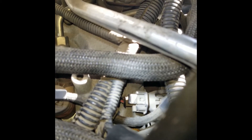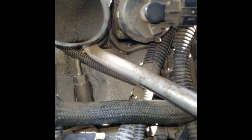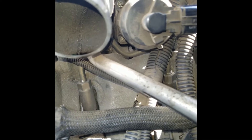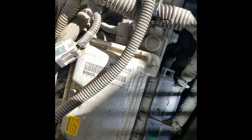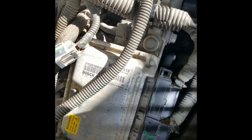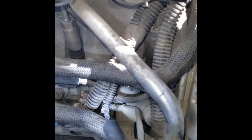It's interesting — the jiggle test identified that it was in fact this one and not all the others that the OBD2 sensor may be indicating. So that is key: jiggle all these connectors before you start just guessing at which cylinder it is. I did the buzz-out test through the components, pulled the connector and did an ohm reading on all of the other bank of cylinders, and I got good readings on all the ohm tests for cylinders two through number eight. But it's apparently cylinder number one that I didn't check, and it's been an intermittent problem.